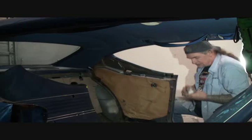While I'm in there, I'm going to go ahead and grease up his rollers, the rollers for the crank up windows. And you can see that right here. Here's our crank up window. So what I'll do is I'll get down inside there, and I will take the paper backing loose over there, and then I'll grease his rollers up for him, so that way he'll have a nice, good, easy rolling window, and the rollers won't break and become a nightmare with that angle.